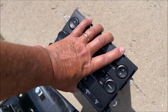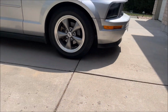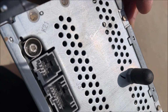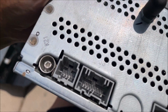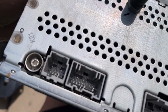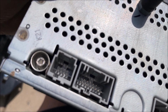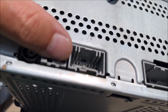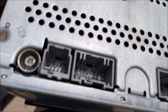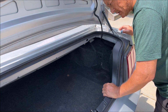And I think it has some special things for the rear subs, but let's look at the back of this here. So this plug here is the one that the sub wiring goes to, the front and the back subs. The front subs, like I said, are in the wiring harness already because I have a Shaker 500, but the other pins are not in that harness, and I'm gonna add the wiring so that this plug will have 8 wires, or actually 6 wires are used, so 6 wires in it that will be used.